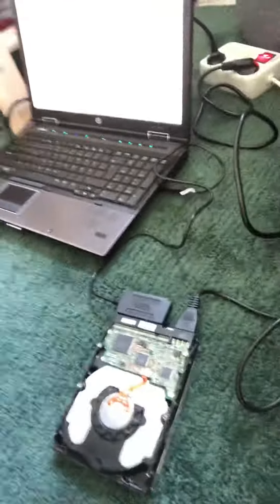One of them, which I know has some stuff that is rare and I don't have it anywhere else, I connected with this little USB thing and then it said crunch when I connected it. I could see that one of the solder pins on the PCB itself had come loose, so I figured the drive is dead — but let's give it a shot.